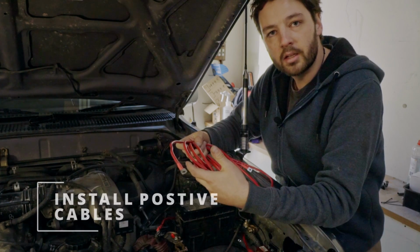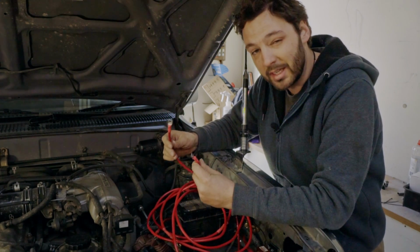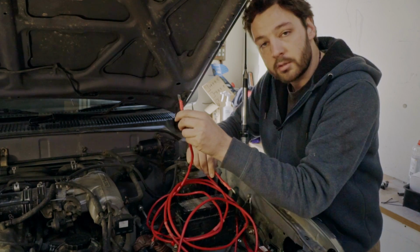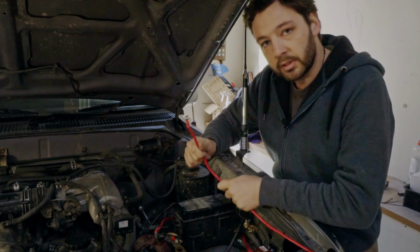As I mentioned before, run it down the side of the vehicle where already my power cables are. Big thing here you have to take note about is of course running the correct end of the cable. If I'm running this to full length, I don't want to take it back out again. So big thick one goes onto my isolator, the square one goes onto my fuse, which is at the back of my car next to the additional battery. So we'll run the square one.